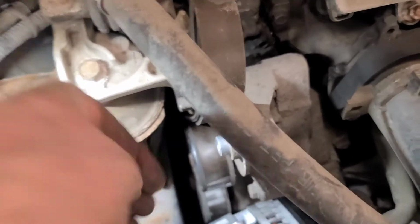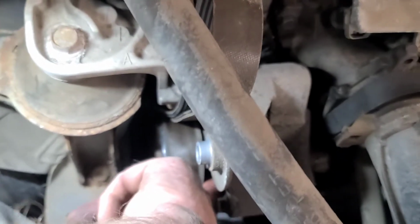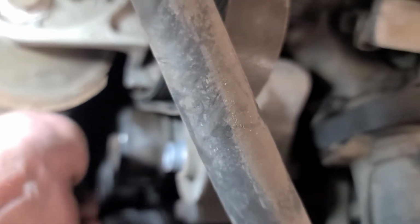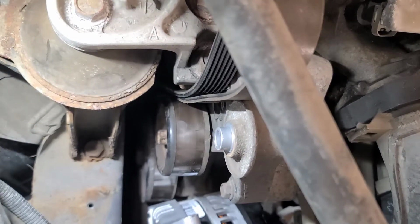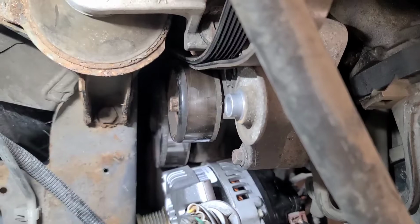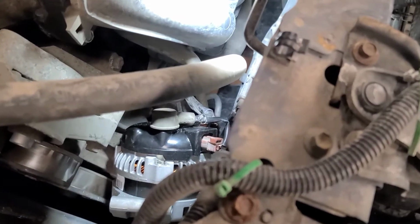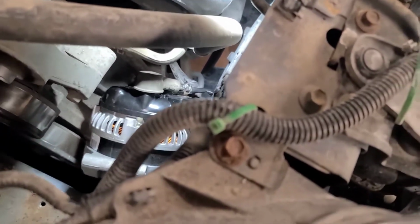So make sure, after you put the alternator down in place, before you bolt it back up, there's a nut that goes in the back of the tensioner that falls down, and you have to get it in there. It's in a little hexagonal boss, so it can't turn, but it'll fall out, and you can't get it in with the alternator in place. I also found it easier to reattach the wires and that retaining clip before mounting the alternator in its place. Put that parking light back in.